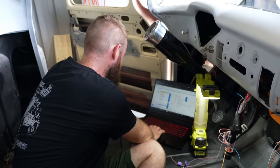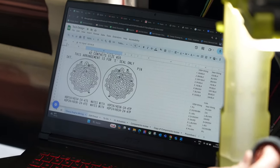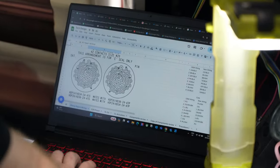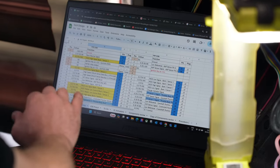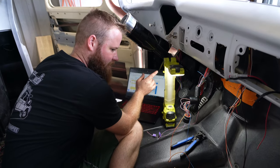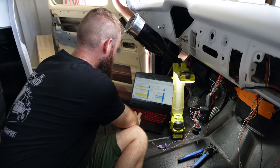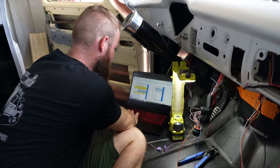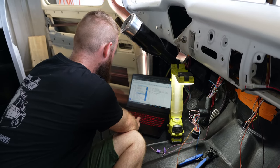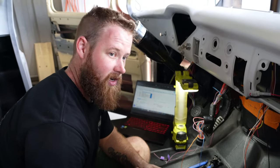I've made this little spreadsheet up for myself just to keep track of everything. I've got the pinouts, which is basically every one of the pins in the bulkhead. I'm basically running through this to work out what the color is, what the function is, what pin came out of the LS ECU, and what it corresponds to on the engine side. I'm just going through so I can keep track of colors and where everything is in the pins, in case I have any issues later on. But it also just helps me work out what I'm doing, because otherwise this is just a big spaghetti mess.